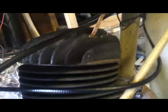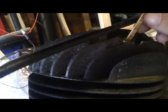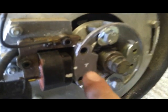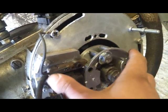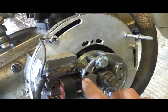These older single cylinder bikes, for some reason — I suppose it's just ease of calculation — have timing retarded in millimetres of piston travel rather than degrees. This particular bike is about 5 millimetres. That stick is at a slight angle so this isn't going to be wholly accurate, but if we rest it in there you can see it's on the 5 millimetre mark. We can then just crank this thing backwards, because we know we're at top dead centre, until that shoots back down — that must be 5 millimetres. So now we know this will fire about 5 millimetres before top dead centre.